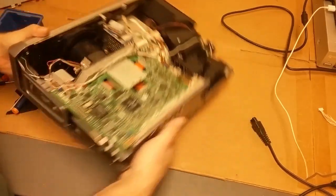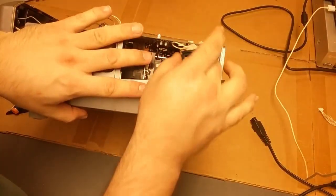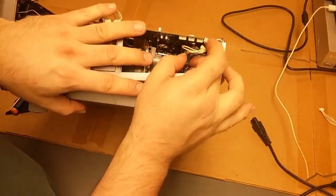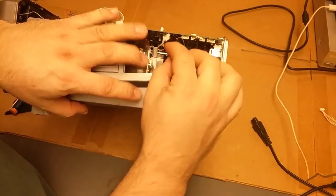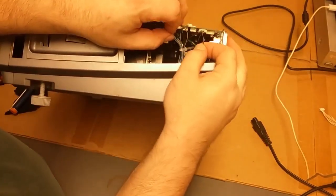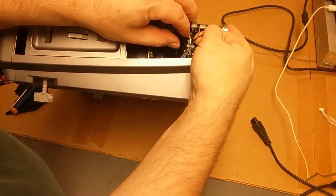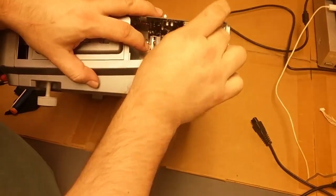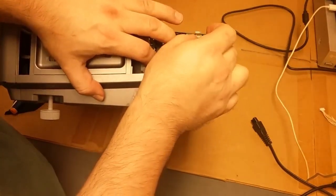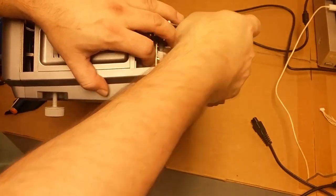Hi everybody, we've got a Sanyo PLV-Z4 LCD projector to look at today. It is functional, makes a picture, but the picture's not very bright and I think the color is off. It's kind of a yellow or orangish tinge to the picture. So I suspect the panels might need some cleaning or the polarizer for the green might need adjustment.